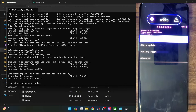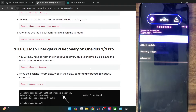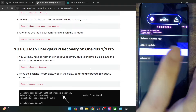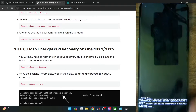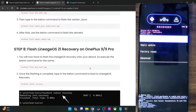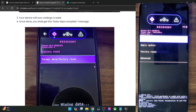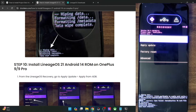Let's proceed ahead with the next step. Your first course of action is to do a Format Data. Note that this will wipe off all the data from your phone. Select Factory Reset, then Format Data / Factory Reset, and select Format Data. A format data is compulsory if you are doing a downgrade — there is no escape from that. Once done, come back to the home screen and now you may do the sideload of the Android 13 or the older version of the ROM file.